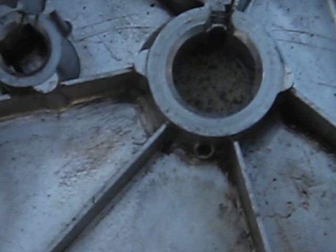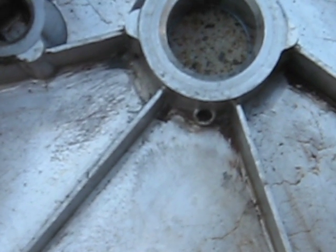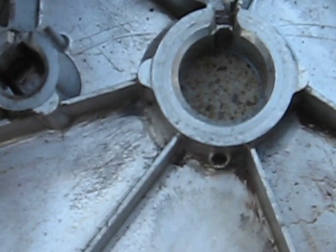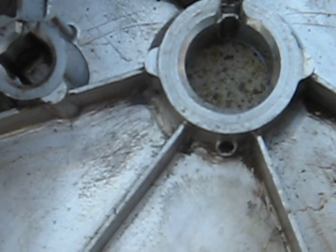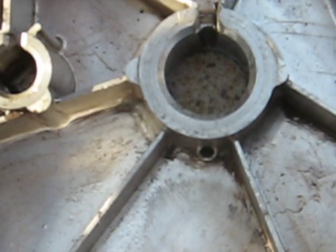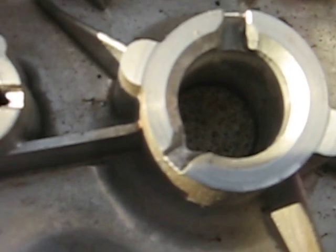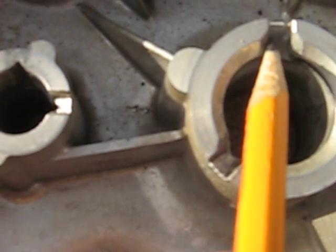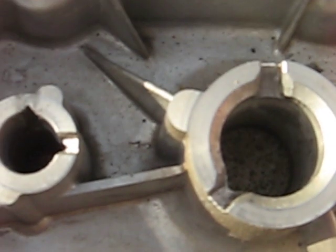As you can see in this one, it actually slopes from the crankshaft down towards the top of the cover. So this one slopes the opposite direction. You'd want to change the slope on that so that it feeds more oil in.